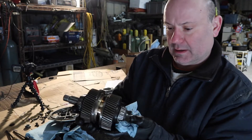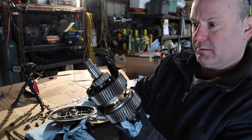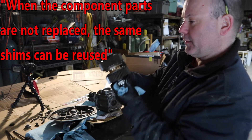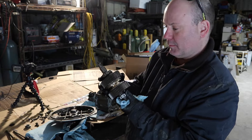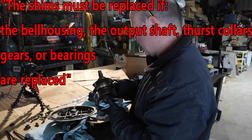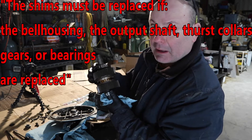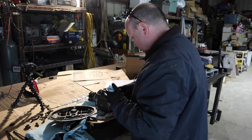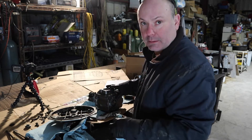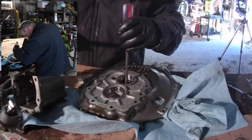There's a little bit of play, but I think this bearing is tapped on as far as it needs to be. Otherwise when you put it back in the transmission it won't go together because there's too much space. I didn't really find a measurement for how close it's supposed to be. There's something about shims mentioned but I haven't come across any shims, so maybe there should be some in here - I just don't know. Next thing is replacing these oil seals.